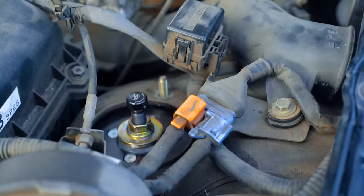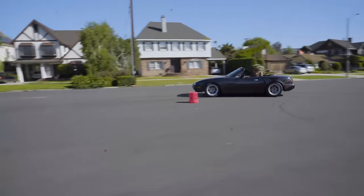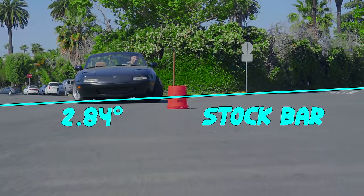It's no secret that I want to make this Miata handle as good as possible. And if you've been following along, you know that we've already done a set of coilovers on the car, which is huge for the way this thing handles. But there's still a lot of body roll in the Miata, and coilovers alone just can't do that much against body roll. So today we're gonna combat body roll by installing a set of sway bars. We set up a little slalom course here in my neighborhood, and I'm gonna go through it with the stock sway bars on to see just how much body roll we have currently. Then we'll install our new beefy chunky sway bars and see how much body roll we have afterwards. I'm not really a betting man, but if I were, I would bet that we're gonna significantly reduce the body roll with the sway bars we install today.